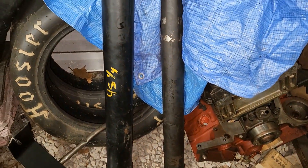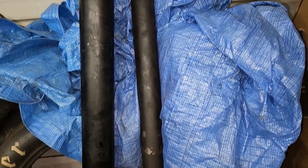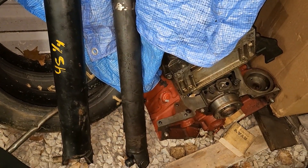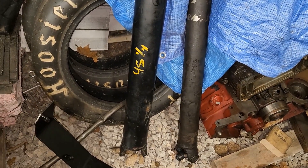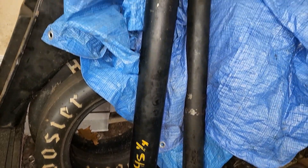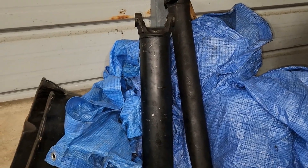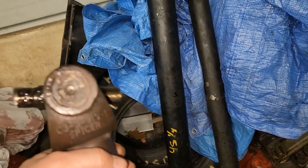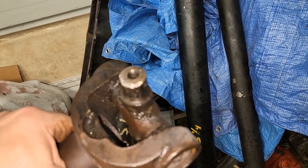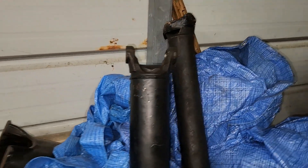Me and Jake Austin did some driving around and we traded his three-inch aluminum driveshaft out of his car and my old driveshaft out of my 96 Camaro, because I put that Turbo 400 in there aftermarket. We found this one which is 44 inches center U-joint to center U-joint. I measured that we needed 44 and a quarter, and it had a big Turbo 400 with snap rings on it — that huge joint. I like to never got it out but I finally did.